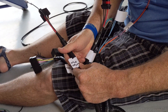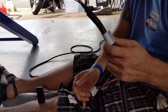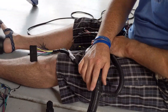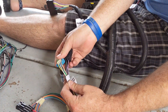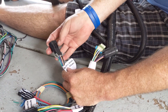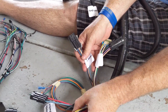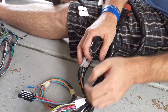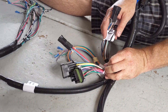Headlight switch. So we could use these wires — it's a wire to our headlights, so that'll be under the dash. Rear harness — we're using some of that for lights and such. Sending units and choke, we're not. Inertia switch, maybe. So that's if you get in an accident, the inertia switch stops the fuel from flowing? Yeah.